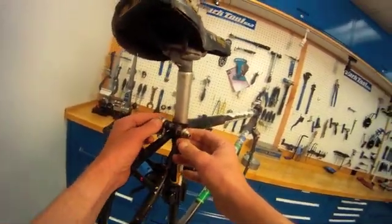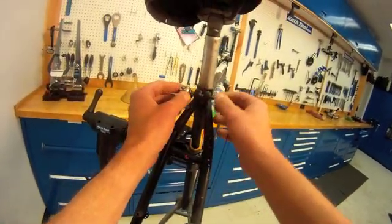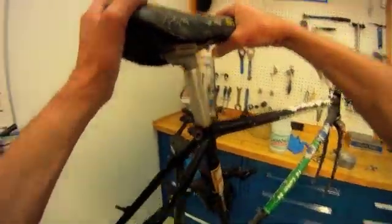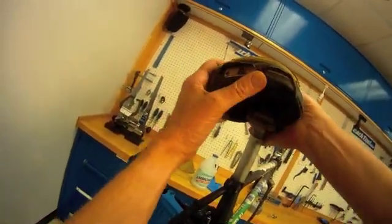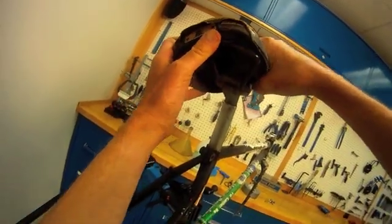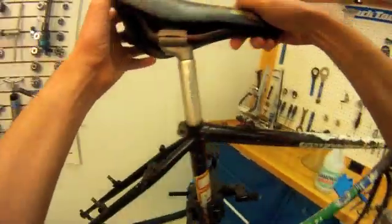We do have the seat binders completely loose here — step one in any such situation. Check that the binder is loose; in fact we'll just take this off. We do have some damage we can see. The seat post was attempted to be removed with a lot of pulling force. You can see that the seat has been damaged — it's been forced so much, just trying to twist it free. So that's trash.